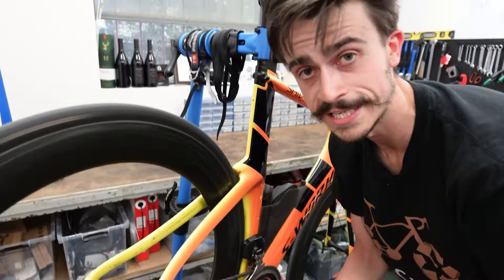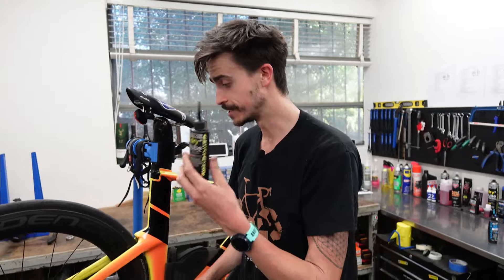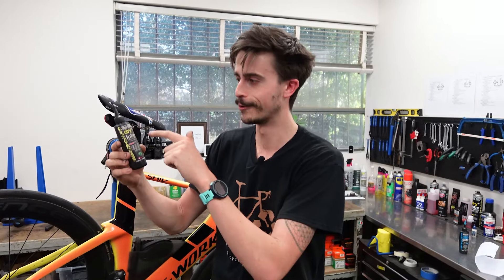Can you hear that? The squeak is gone just by putting chain lubricant on. I'm a big advocate for chain lube — you can hear a dry chain from across the road sometimes. A lot of commuters don't think about it and then the bike shop tells them they need a new chain. Yes, but you forgot to lube it, so you wore through it much faster. Chain lube keeps it quiet and prolongs the life of the chain, saving you money.